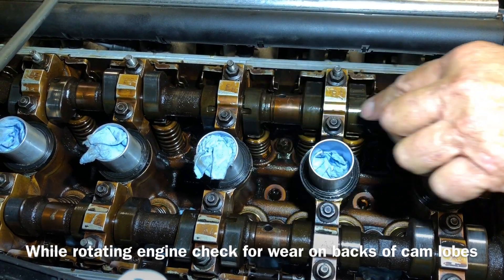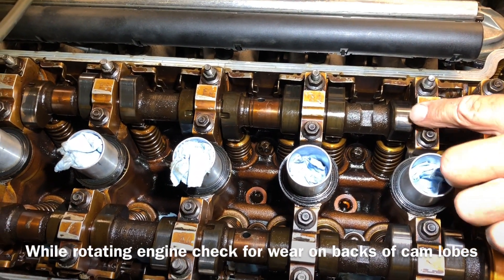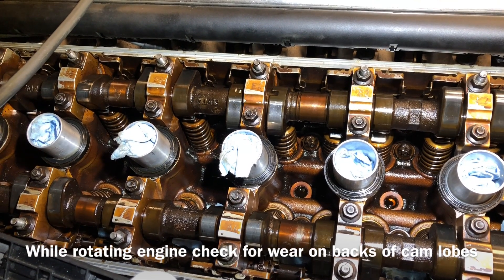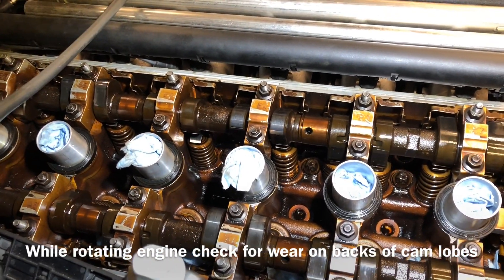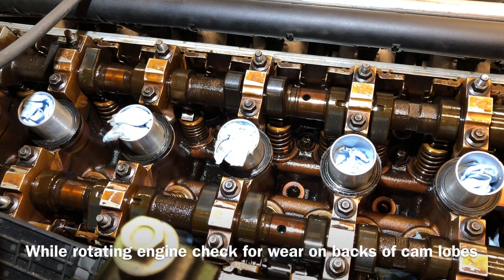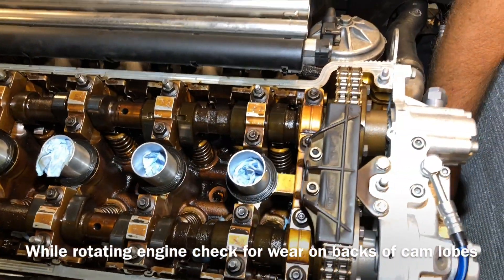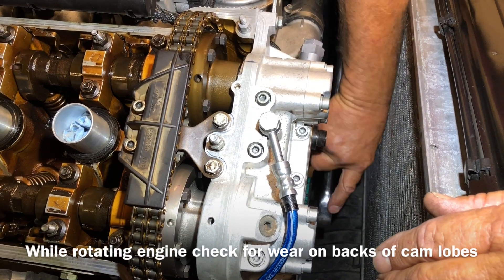You can see this greenish oily color here — that's a good sign that means you haven't had a tight valve restricting proper clearance. If this was shiny like the surface right here on the back side, marks like that on the back side of your cam lobe means the valve train has been rubbing against the cam — that's not a good thing. We're bringing it up right now to where we're on the back side of the cam lobe. I place the feeler gauge in a very vertical position, and I don't crank the engine backwards much at all — I try to keep it going forward. To do this properly you need to remove the fan and fan shroud to get down to the crank with a 32 millimeter wrench to turn the engine over clockwise.